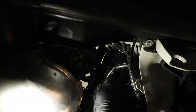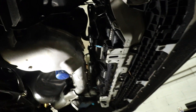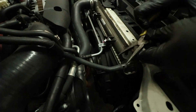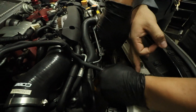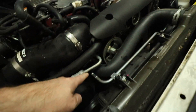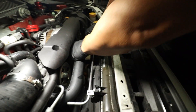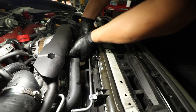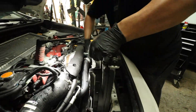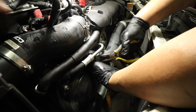When it's fully drained, go ahead and pull the radiator out from the top. Next we're disconnecting these two hoses, then disconnecting the two clamps for the bigger hose. We disconnect the side of the hose that goes to the radiator first, then pull the radiator out. We found it easier to remove the clip on this side of the hose after the radiator was already out.